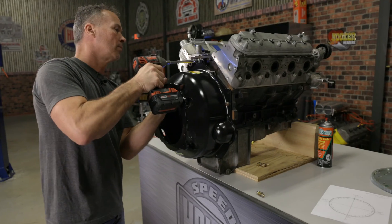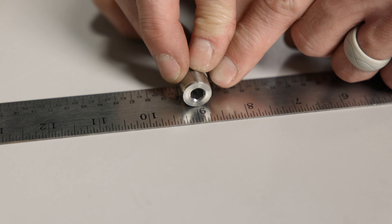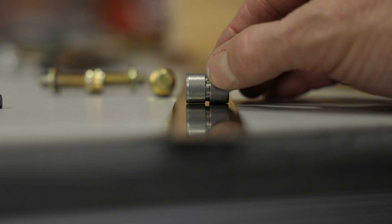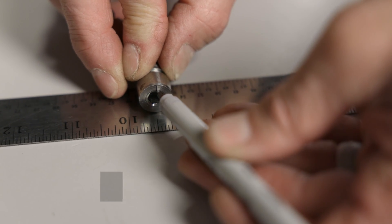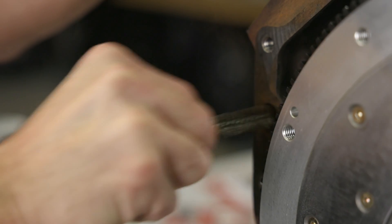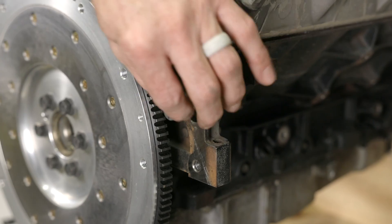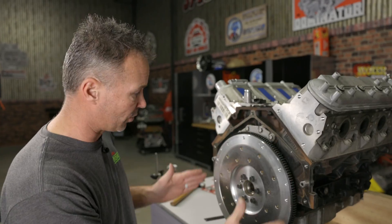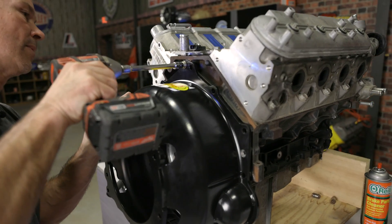To install them, you'll first need to remove the bell housing, then the stock dowel pins. You can drive them out with a hammer and punch or pull them out with a pair of locking pliers. To determine the highest point of offset, place the pin on a ruler. Starting at the first point of contact, roll the pin until it once again makes contact with the ruler, then roll it back half the distance. This is the high point of the offset — mark it with a marker. Thoroughly clean the dowel holes in your engine block and lightly coat the new dowel pins with some oil before installing them. Make sure you're using a set of matching dowels. The offset or high side of the dowel should be facing in the direction that you want your bell housing to move. Both pins need to have the offset parallel to one another, meaning the high side of the pins are facing in the same direction. Once you have both pins in, reinstall and tighten the bell housing securely.